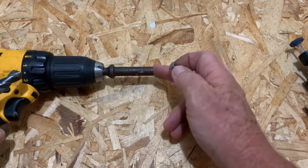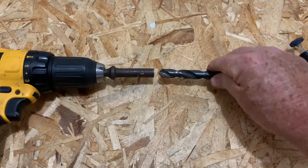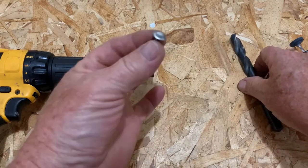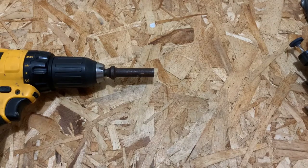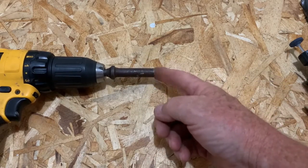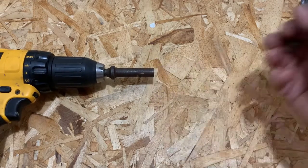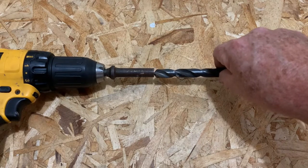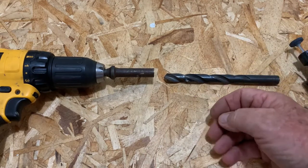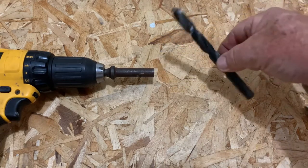So what you want to do is make this a little concave in here. Like many of you, I went on YouTube and they say take a drill bit and drill the center of this, and that'll give you a nice concave surface to help hold the rivet. It sounds good, but I've worked with metal long enough and had a metallurgy class to know that most of the time, chisels and tools like that are usually hardened steel or have been heat treated to make them hard. So it is very hard to use a drill to make that concave. I even tried it on this one and didn't have any luck, even with a drill press. For the average person, this is not going to work.